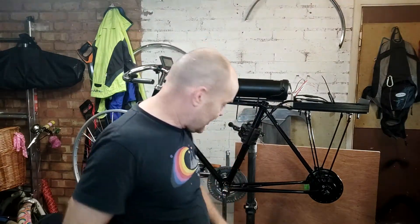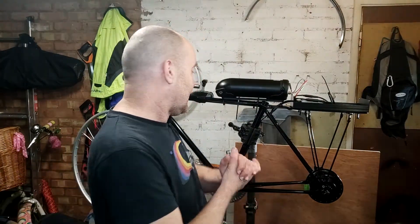The next thing to check is the cranks — does the pedal assist work? When I turn the pedals, will the motor kick in to give me assistance while I'm riding? I've already tried this — spoiler: it does work. But when I was setting this up I had some problems and initially it didn't work. The C1 setting on the controller within the setup — I started that at zero and my pedal assist wasn't working. I kept incrementing that value, and eventually on C7 my pedal assist started working. So that's a tip: if you have problems, keep raising that value up.